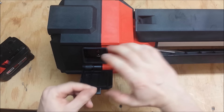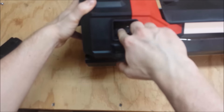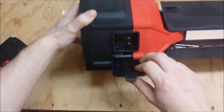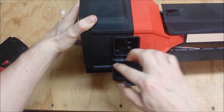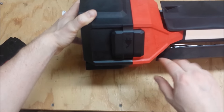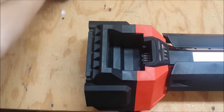You've got your AC port right here. It doesn't have a grounding lug, but it's probably a double insulated tool so it doesn't matter. Then you've got a rubber gasket around the outside, and there's a little lip in here that contacts that. It's spring loaded so it closes back up when you're not using it. Alright, so that's the charging port and AC port.